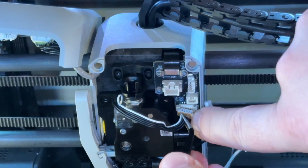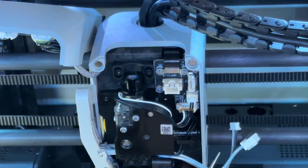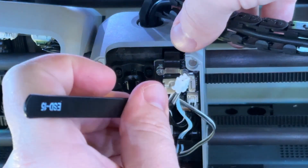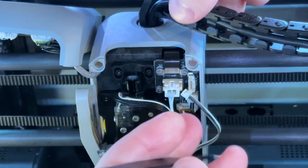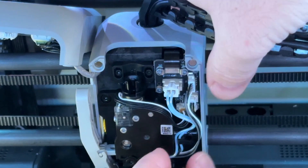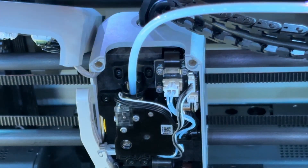We're almost done — we just need to connect all the cables back up, so there'll be four cables in total. The first one is the one that had glue on it for the extruder gear assembly itself. Then we have a tiny cable — there's a little cable holder on the side — and the tweezers are really helpful for grabbing these cables and aligning them to the pins. Working with these small cables with your fingers can get really frustrating, so tweezers are very helpful. Then tidy up the cables by putting them behind the cable holder. The final step will be to put the PTFE heat tube back in the top and put the front cover back on the tool head, making sure it is securely fitted.